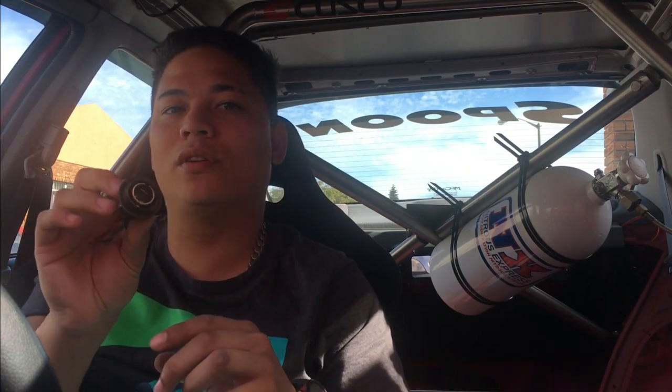The way that we are going to do that is use a double contact holder. As you guys can see, there are two little dots here. One is for it to remain as a park light, and one will also be an indicator. This needs to be adjusted in order for it to fit the OEM headlight or indicator, and then afterwards we have to do the wiring.